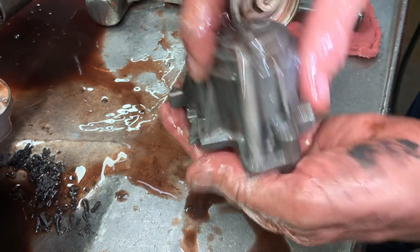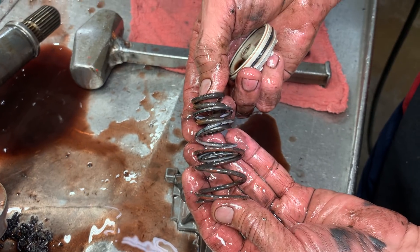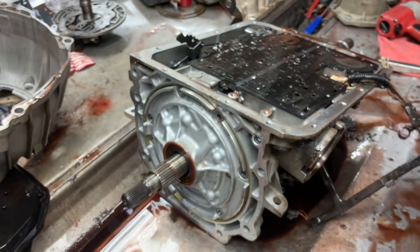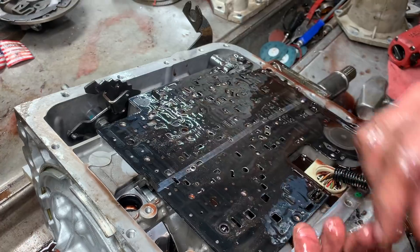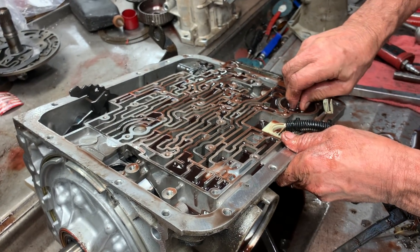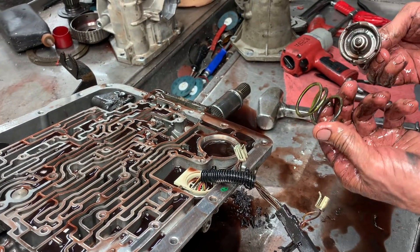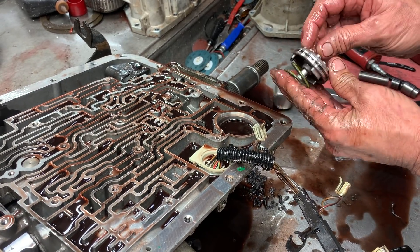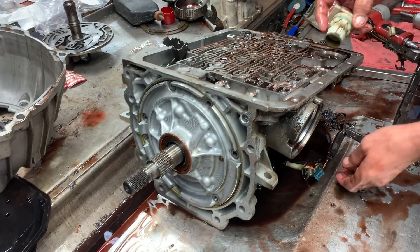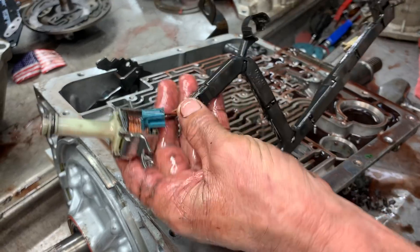That's why we always upgrade to aluminum. This does have a shift kit in it — you can see the three springs stacked inside of each other. We like to stack it up to where we get this piston flush and always raise your piston to the top. There's also a shift kit spring. We'll take and stack a double piston here and block that — that just makes fourth gear so much better. The harness is good, had no fluid in the connector, so we'll cut this off and solder in another solenoid into the harness to save it.